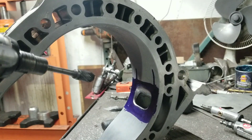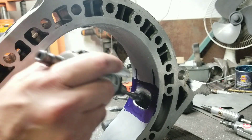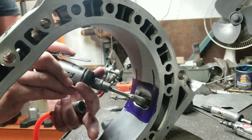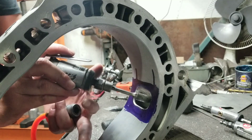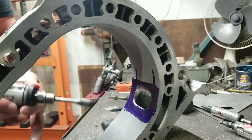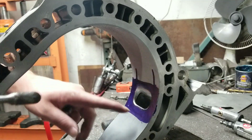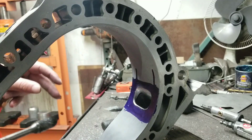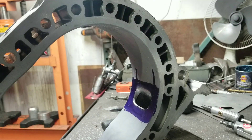You can see I'm actually porting in this direction and bracing with my hand, or in this direction — both making sure I keep the porting tool secure so I don't accidentally skip out onto the rotor housing face. Always making sure I'm considering my airflow. We want to make sure we don't have anything that's too sharp of an edge — we'll be radiusing those down before we're done.